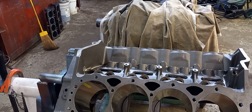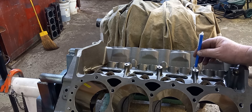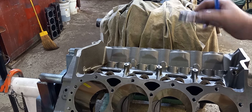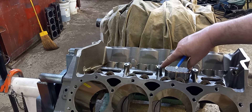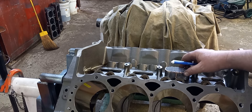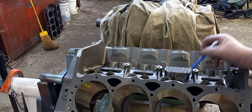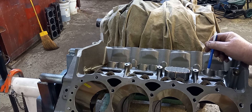I'm going to make up some little stacks, and then utilize the OEM type spider hold-down for the hydraulic roller lifters to hold these down. I got one made up, and I'll put a tab on it — it'll hold this one and they'll all hold down. It also slows down the oil. I could pot these with epoxy and hold them down, but I don't know if I'm going to do that — I haven't got that far yet in my thinking on it.